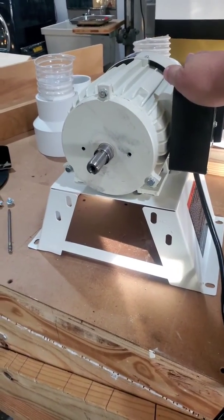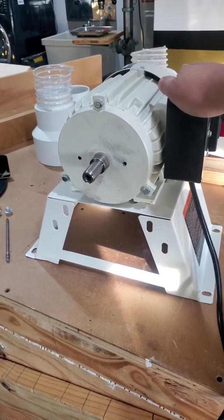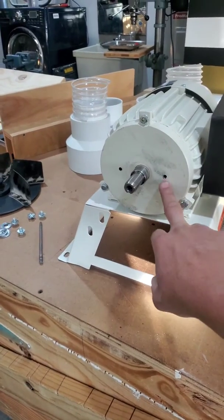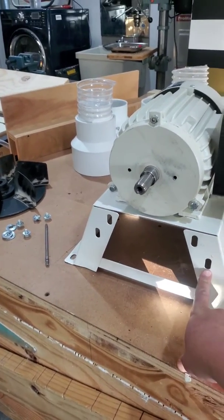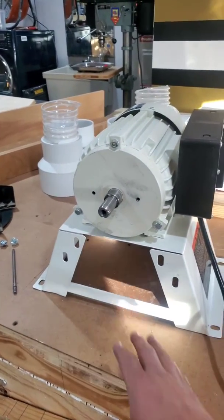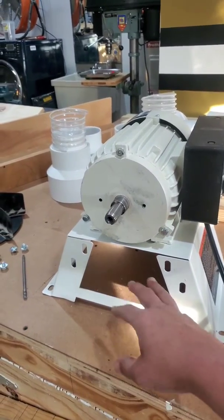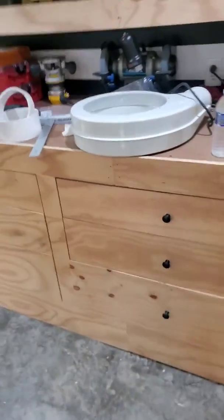On my Jet 1100, I am reorienting the shroud for the impeller. All you do is take the impeller off — there are two Phillips head screws here, take them out, and then there are some bolts that you have to get from the inside, so it cannot be mounted for you to reach them. I believe they're half inch. Anyway, you take it out — I've done this many times — and make a stencil.